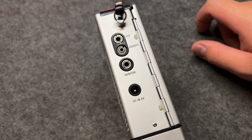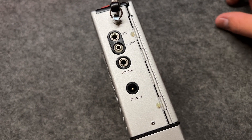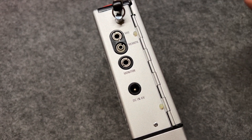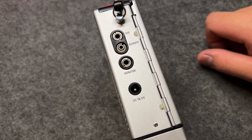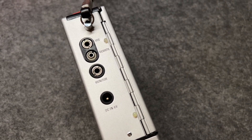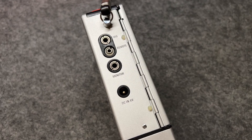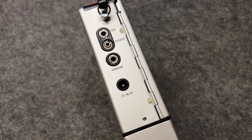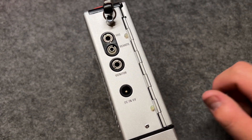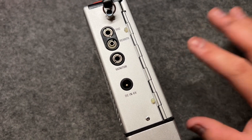One important thing when dealing with such delicate, old-school machines: you have to watch the positive and negative tip of your adapter. Most people pay attention to the voltage, but sometimes it's the polarity that matters. For example, the Sony D6C — I got one, and when it was shipped to my home, the CX200A4IC chip was completely blown up because the previous owner accidentally used the wrong adapter. So whether it's 6V, 8V, or 3V, you have to watch out and check the positive and negative tips.